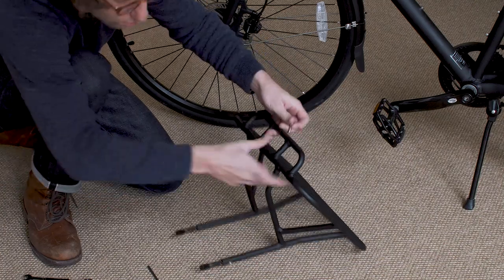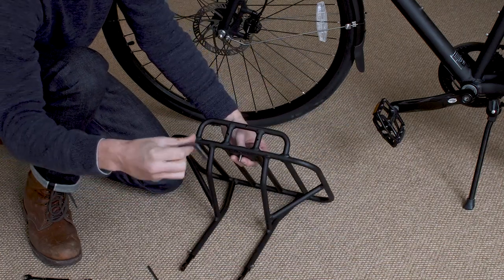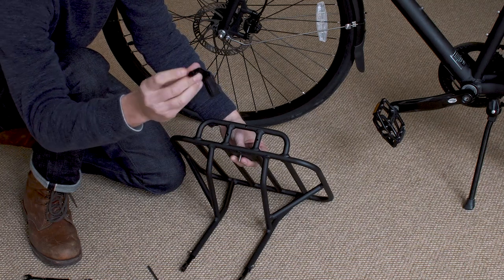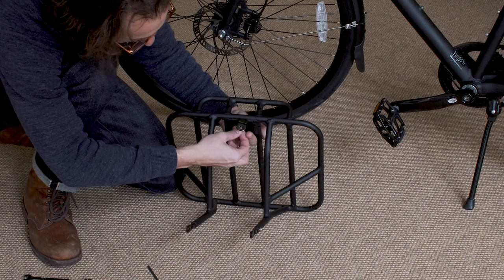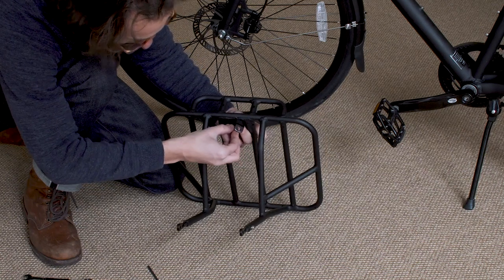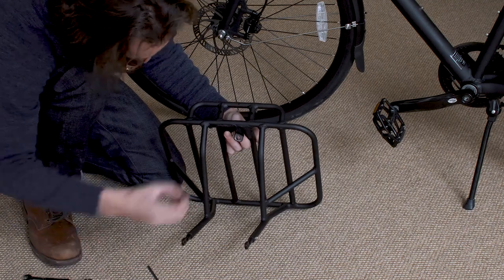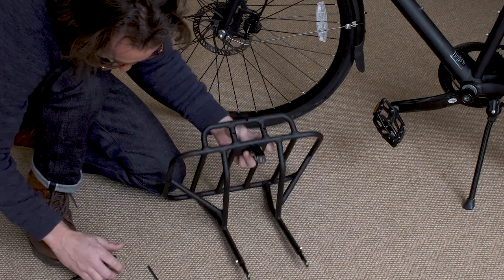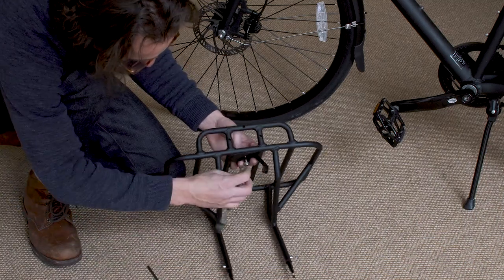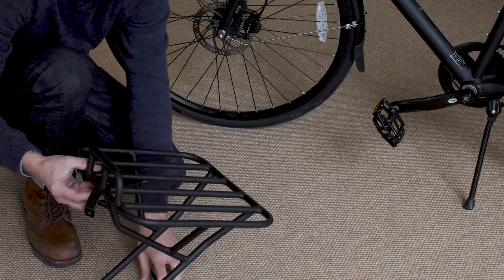Now, with the backstop of the rack facing you, grab this mount and the flathead bolt. Stick the flathead bolt through the rack. Make sure that the single hole is pointing out. Use 1 washer. And 1 nut. And loosely tighten in a center position.